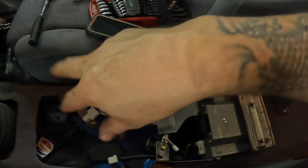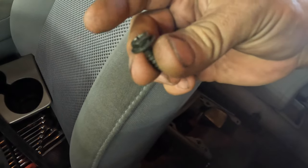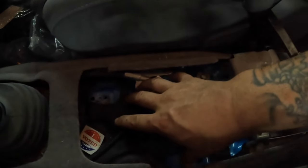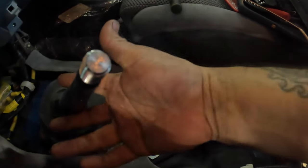When we pull the two out of the center console, there are two — either Phillips heads or 8 millimeters — little black ones right here. You can take those off and the whole back piece slides off. They look like this, and they go into those two spots right there. Then whenever you take these two that were inside where the cup holder was, you just take the shifter knob — which just unscrews, regular threaded — take that off, and then you pull back and the whole center piece where the shifter is will all come out in one piece.